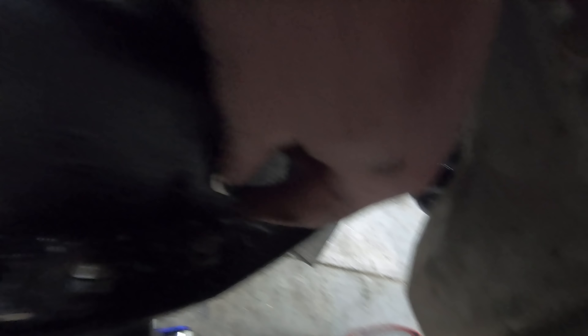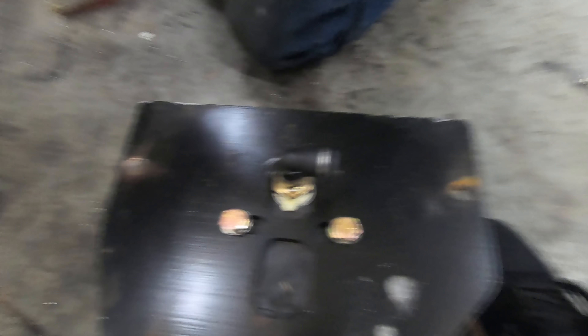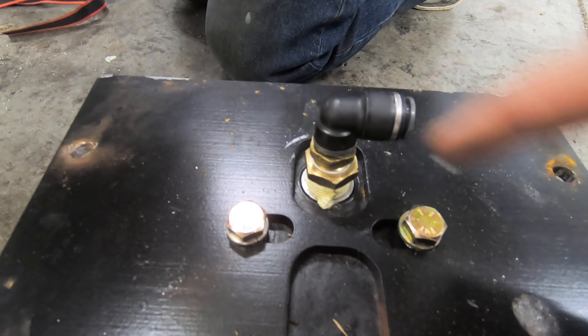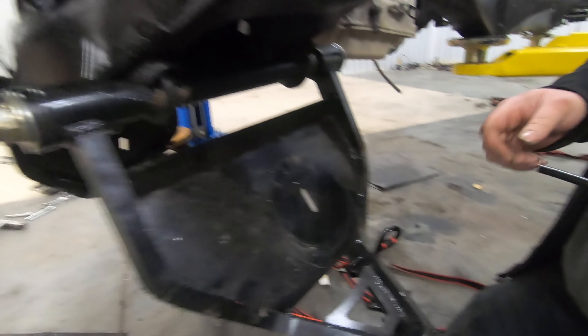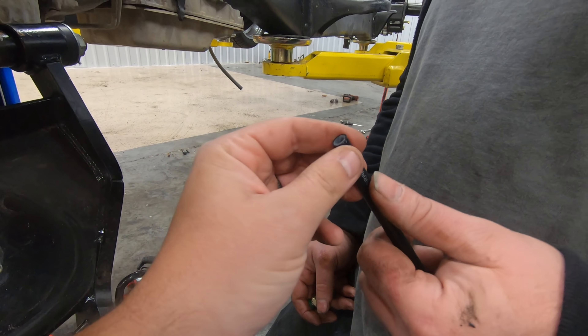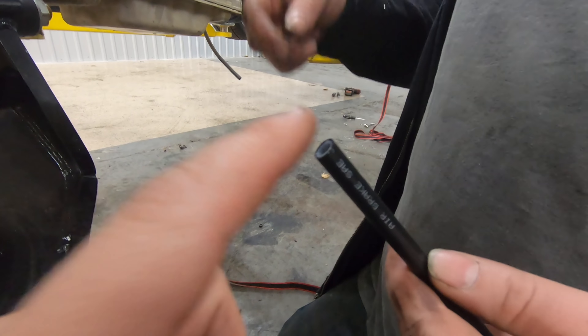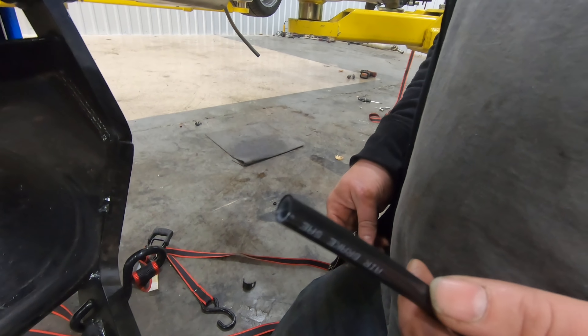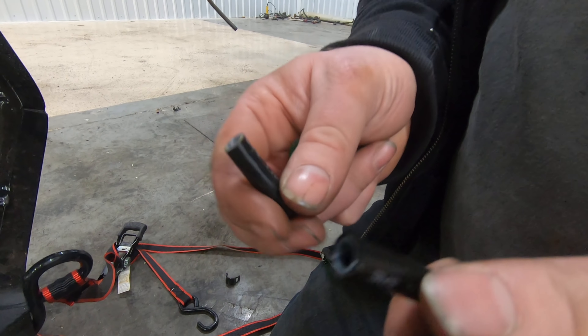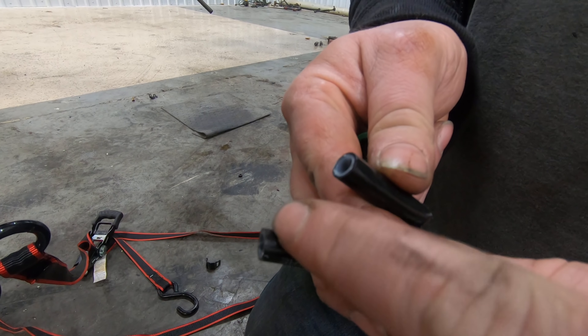It's looking nice in there. Then we'll come out here with the 90, go over the cross member to the other side and it'll look real nice and clean. We're redoing some of the work from previously. For the C10 Fall Revival we're actually getting this right — we've got the proper fitting inside the top of the bag, the proper 90 fitting. Mike installed the bulkhead. You can see the hole he drilled right there. Now we put this nut on it and run our poly line in. For those who've had airbag suspensions — make sure you cut this line straight so it doesn't have any burr or imperfection on the end, so it'll seal correctly in the push lock. You don't want a 45 or a 10 degree cut. You want it straight.